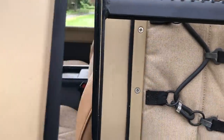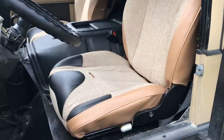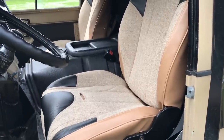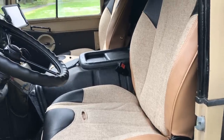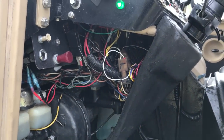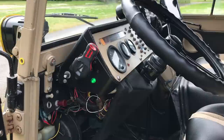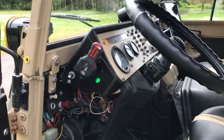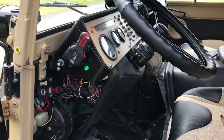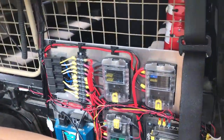Finally going inside — I'm running Mastercraft Baja RS suspension seats, which are incredibly comfortable. I added aftermarket 24-volt seat heaters, because this thing does not put out much heat, so the seat heaters give me a little bit of warmth. I've got an idiot light that I added — yes, it's a mess under the dash, and that'll be a future job to tackle all that spaghetti wiring. I also have a wireless winch controller. The idiot light is my reminder that I have not turned the master switch off — that the whole system is still powered. Behind the driver's seat you can see some of the wiring complexity it takes to run all of this.